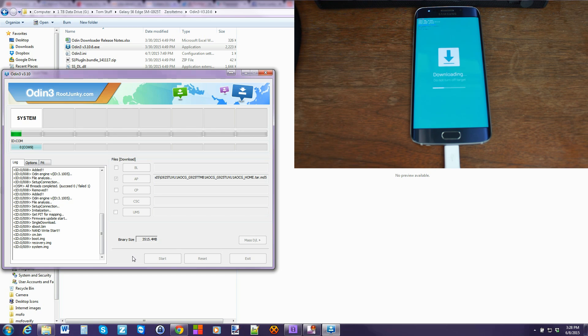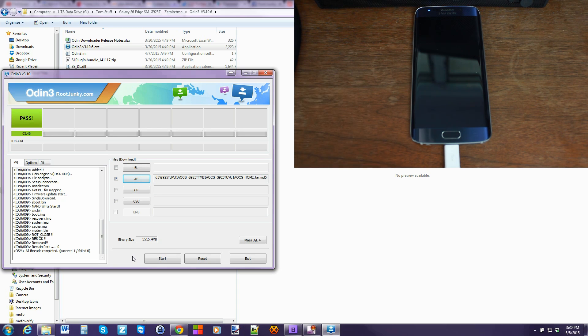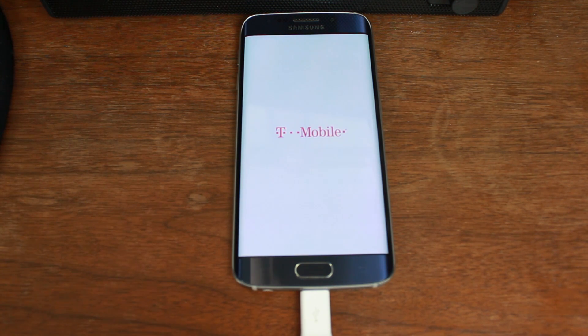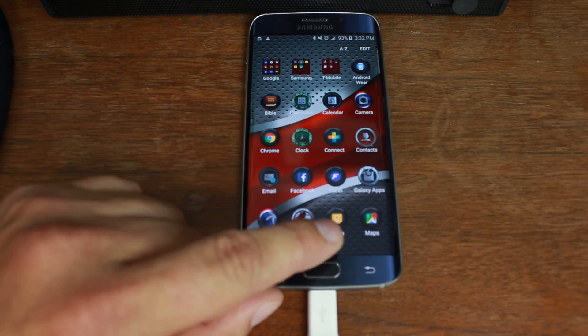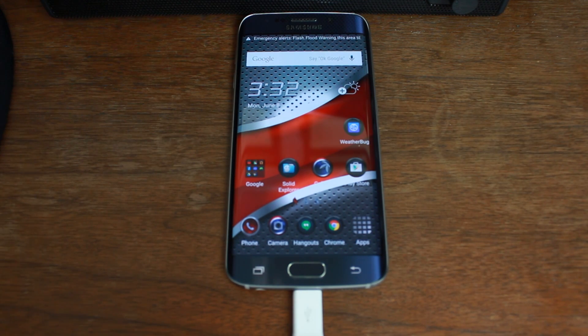Let's let this thing flash — the system is going to take the longest, it's about halfway through now. As you guys can see it has passed here on the computer. Our device is rebooting and going into recovery mode — right there it is wiping data. So you will have a fully completely restored device once it is done. Once we're done on the computer, you can close out Odin. The device is fully booted back up. It looks like it does not actually wipe your data, so if you wanted to fully factory reset it after the Odin restore, you're going to have to boot into stock Android recovery and manually factory reset — I have a video on that as well.